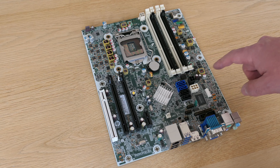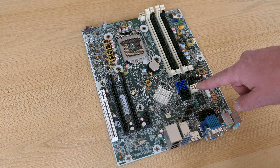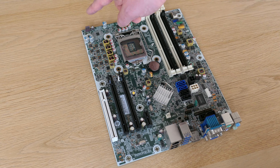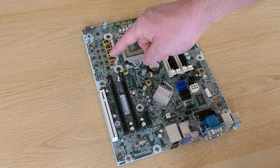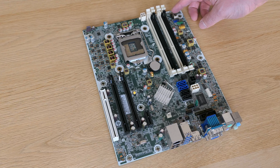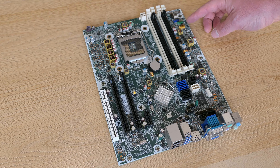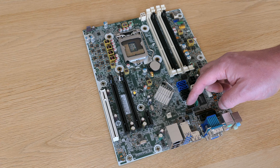The power supply is connected to the motherboard with only three connectors: main power input, power command, and P4. It easily slides out as well — pretty handy. The maximum output of this PSU is 240W, pretty high for such a small form factor, but if you equip this machine with the highest supported Xeon and a nice GPU you will need that. Power for SATA runs through the motherboard instead of directly from the power supply, which is pretty common for these kinds of machines.